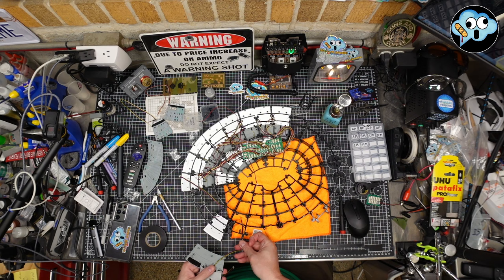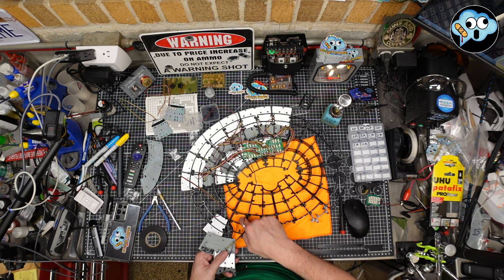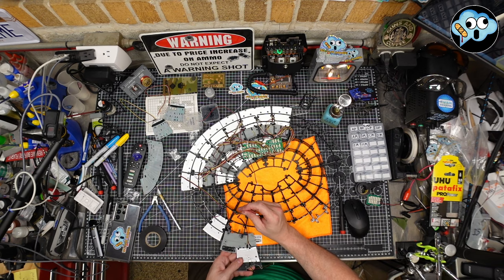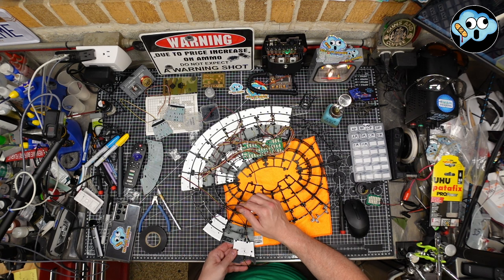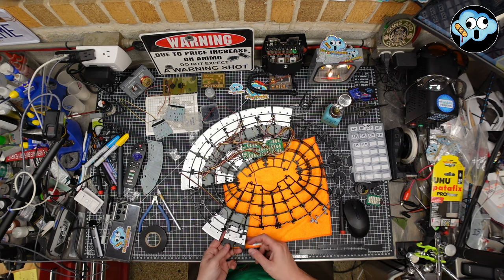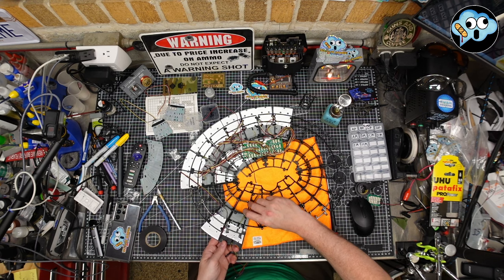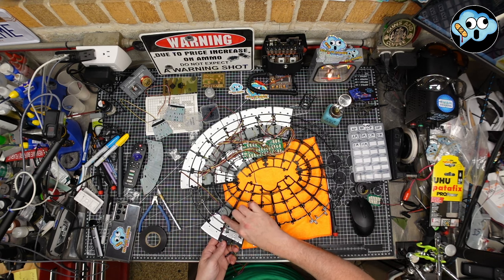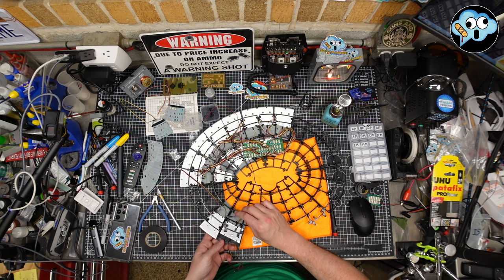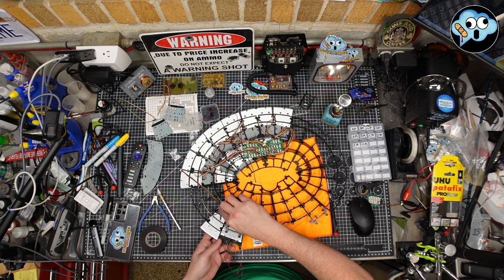So we're going to get this wiring harness through this second opening right here, along with, I guess, whatever this red and blue light is. And then this red and blue one has to go over here to this light port. Okay, I'm probably going to put one screw in the hole, then I'm just going to shove that in there,